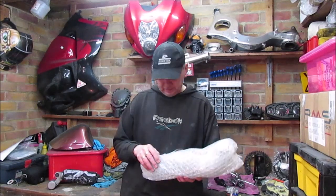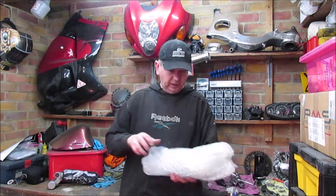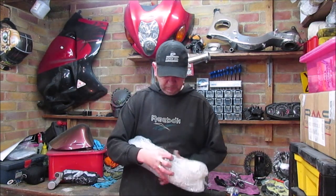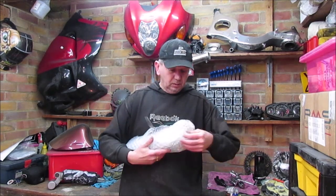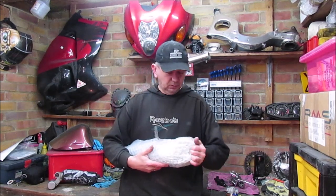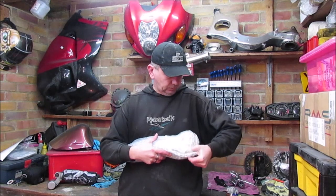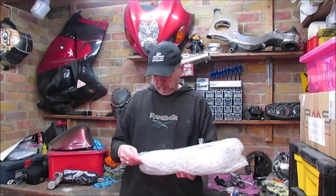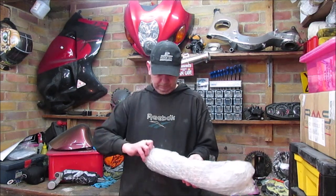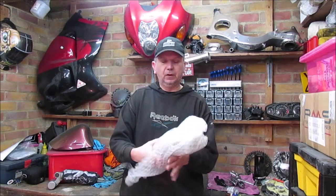So obviously the problem I'd had was because I've changed to a different swing arm, I hadn't taken into account the actual shock. As I said before, the Booster swing arm, Booster rear shock is a 330mm. Obviously I've changed swing arm, which is shorter. I've done a mock-up with dog bones and made it out to be about 340. The S-grade shock is actually 355.